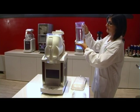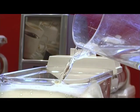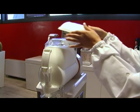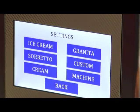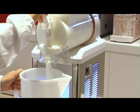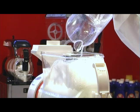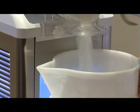Pour lukewarm water into the bowl. Replace both covers, close with the safety lock and start the washing procedure. Extract the bowl's content and repeat the operation until clean water comes out. Once the whole product has been extracted from the bowl, dismantle all the components.